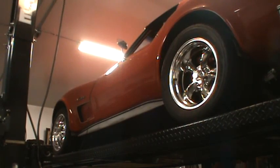One final update on the turn signal situation. I put them down through and into the lenses, and I went and tested it one more time, and the left side, the driver's side, was working the way it did before. And by that I mean no lights with the parking lights, slow blinking with the turn signal only, and nothing with the turn signal and the parking lights.